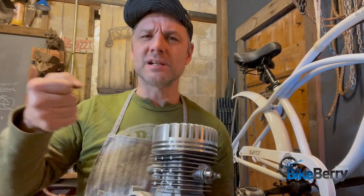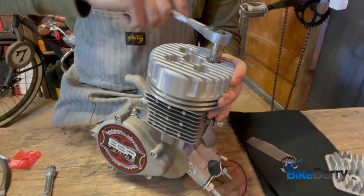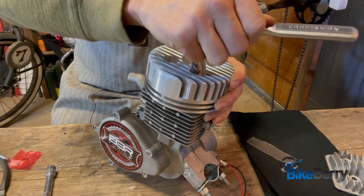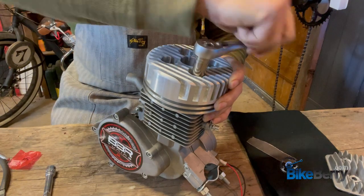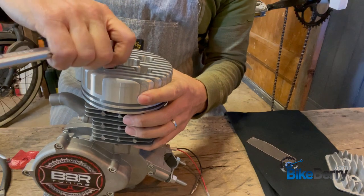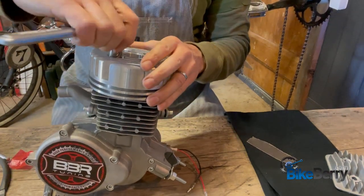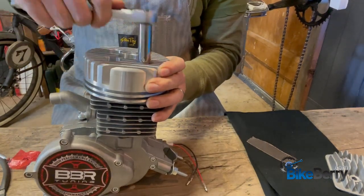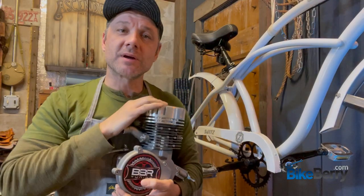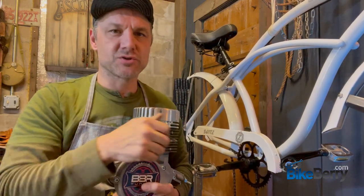If you have a torque wrench, it's about 10 to 11 pounds per nut on there. We'll just get it tight with a socket wrench. You're going to get it good and tight, and I would go opposite — tightening everything a little bit at a time. That's round one. Again, going opposite. I'm confident that everything's really tight and nice on here. But as a final step, after I mount it to the bicycle, I'll go in and tighten this down one more time to make sure everything is good and snug.